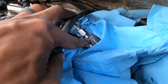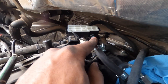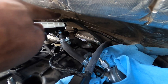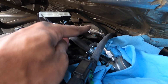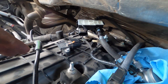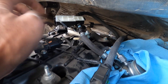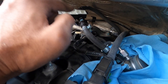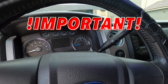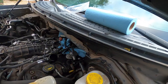There we go guys — we are connected. From the high pressure fuel pump you've got a quick connect, a little bit of hose adapter in between the two quick connects, the barbs into the ethanol content sensor, and then back over into the existing fuel line in a nice smooth curve. The engine cover may or may not fit anymore, but that's not a deal breaker. Now we're going to plug back in that fuel pump control module in the back, plug in the ethanol gauge, and then — not start the vehicle — just turn it to the on position until the fuel rail builds up pressure, then check for leaks. It'll take more than one key cycle to build up pressure.